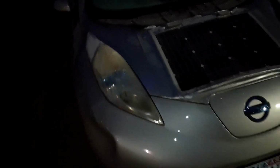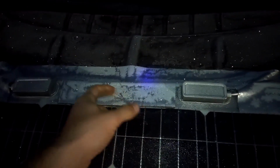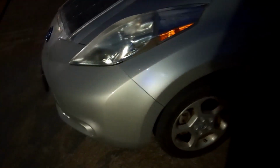Now, if you have a 2019 Leaf or a Chevy Bolt or pretty much every Tesla, you can afford to lose 50 or 60 miles in the range when it's really cold outside and still have well over 100 miles left for daily driving, so it's not really a problem. But if we've got a 2011 through 2015 Nissan Leaf, when they only had the 24 kilowatt hour batteries, you might have a maximum highway range of only about 35 miles left if it's below freezing outside.